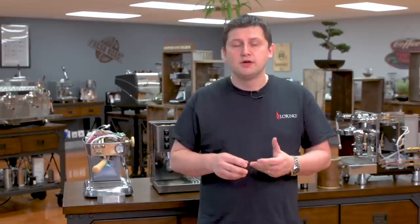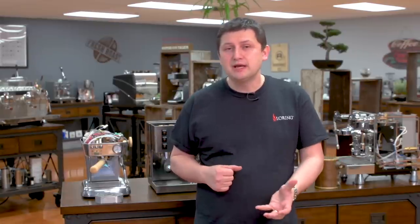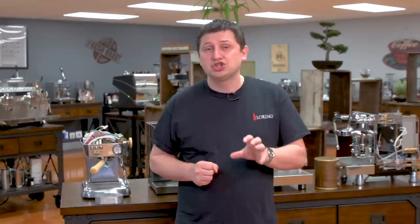I'm going to start with thermoblocks, because thermoblocks are generally thought of as being in introductory level machines. In times past, you would find thermoblocks in all inexpensive machines — things like introductory level DeLonghi's, Breville, things like that. In the past, thermoblocks had a bad reputation for having poor temperature stability and poor steaming ability, and they generally were not regarded very highly. Although a lot of that has changed in recent years with advances from companies like Ascaso and Breville — thermoblocks have gotten to be much more temperature stable than they were in the past.